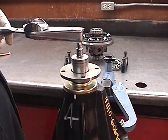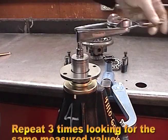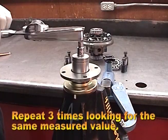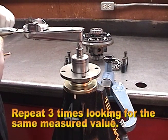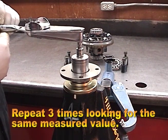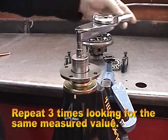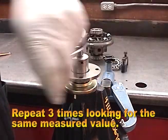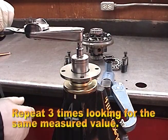You need to tighten this up to a certain turning force. The manufacturer will give you your turning force — their bearing preload — and if they use old bearings, it will be different than new bearings. Place your dial indicator up, give it a rotation, run it to free it, stop, and make sure it's perpendicular. Reel gently until it starts to move — right around 13 to 14 inch-pounds. If you can get that value a couple of times, then you've got a good reading.